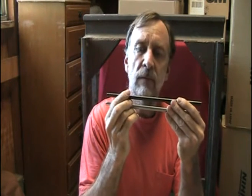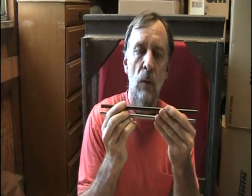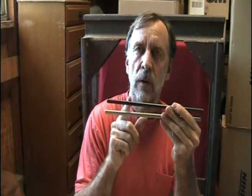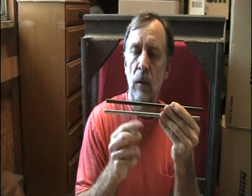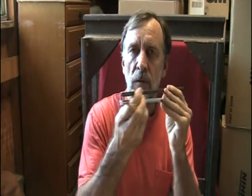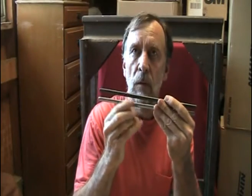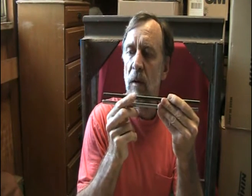Some people say that steel push rods are stronger than aluminum push rods. What I have here are two pieces of push rod tubing. Both of them are three-eighths of an inch in diameter. The top one is 4130 chromoly steel, the bottom one is 2024 aircraft aluminum. You can see the cross section on the aluminum is much thicker than the steel. They both weigh about the same — the steel is 47 grams, the aluminum is about 46 grams.